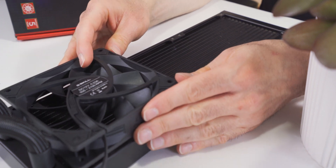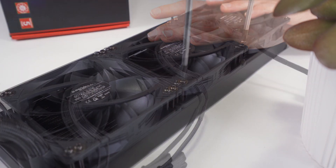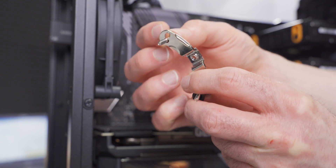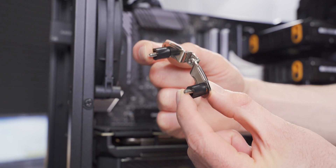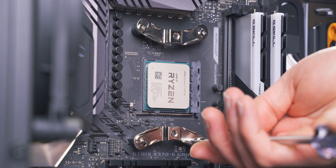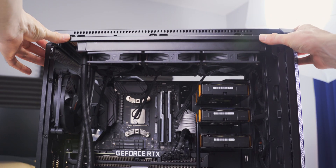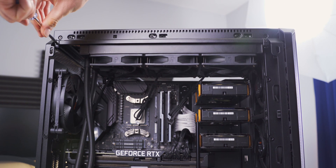Getting this thing installed into a system is pretty much as easy as it gets when it comes to AIOs. First, I went ahead and attached the three fans to the radiator, and I decided to set them up in a pull configuration so they'll be pulling in cool air from outside the case through the radiator. I opened up the package with the AM4 mounting hardware and set up the mounts using the included screws and spacers. Then these get screwed down onto the stock back plate on your motherboard, so make sure you find that back plate because you're gonna need it. Installing the radiator in this case is super easy because it's got this removable tray at the top that just lets me slide it right into place.